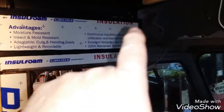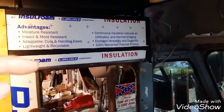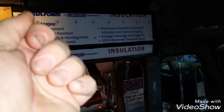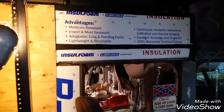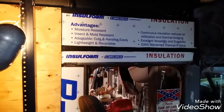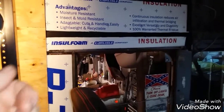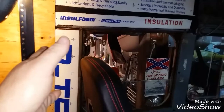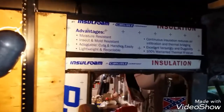To manage power sources, I think I'll simply put a panel in with a cord and three outlets — one for the onboard generator, one for shore power where I can also plug in a portable Honda EU-series generator, and one for the inverter. I'll take a cord with a male plug and plug it into whichever source I need separately, so I won't need any sort of transfer switch. It's a manual system: want shore power, plug into the shore power plug; want the internal generator, plug into there; want the inverter, plug directly into the inverter. That's my 110-volt distribution plan.